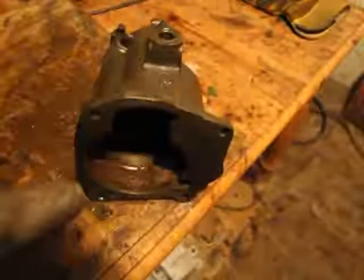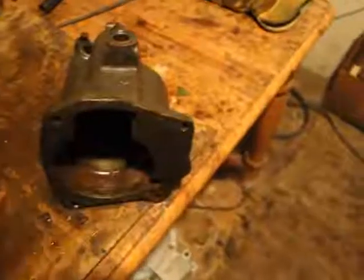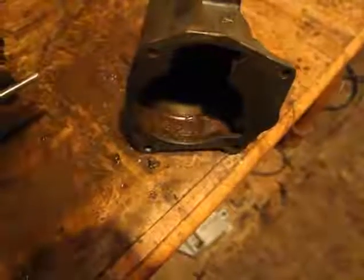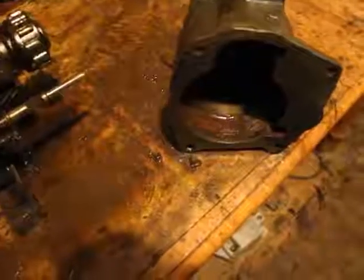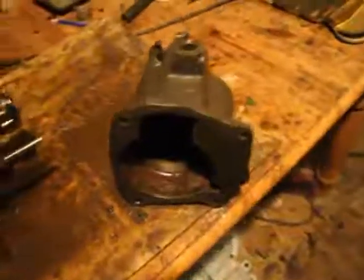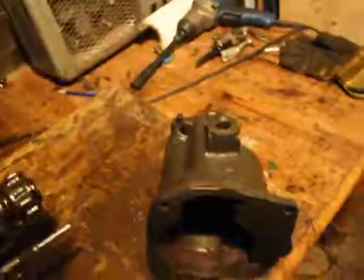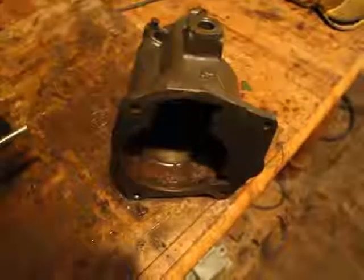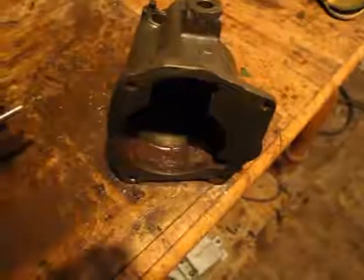Like I said, same with the chisel. Ideally you'd have four chisels, one on each side. You're never hitting these things really hard when you're using metal to metal, okay? If you're using the rubber mallet, go for it. It's not really about the strength, you won't damage it no matter how hard you hit it. But if you're using a chisel, you can break the chisel in there, you can scratch it.